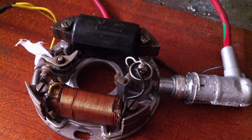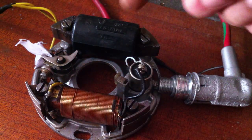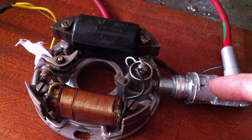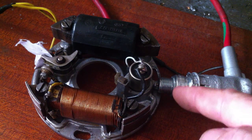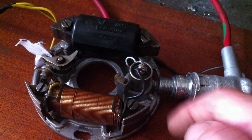This is a VIA engine ignition system used on all the models 6, 7 and 12. There's a Bosch coil here which goes through an HT cap and a good spark plug which is resting on the earth. That's important — you have to have this plug earth.